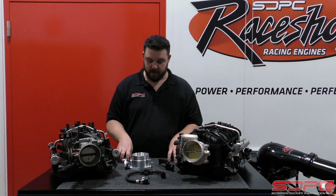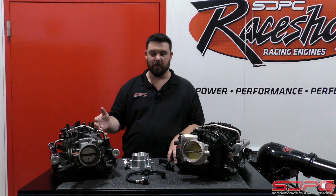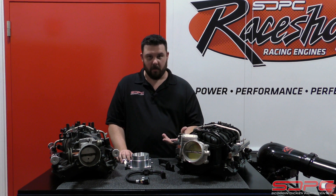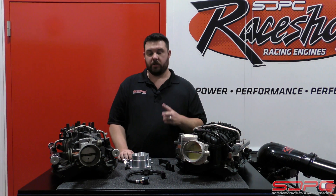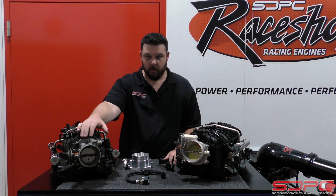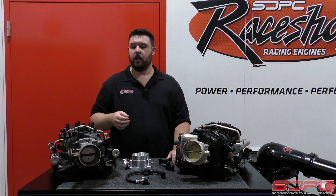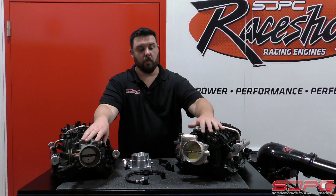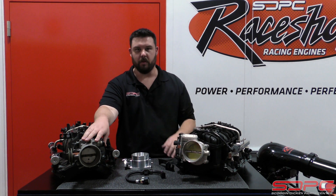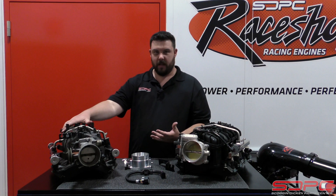The next is going to be the throttle body connections. Now your 99 to 02 guys, you have kind of a bum wrap on the fuel system having to convert from return style to returnless, but you catch a break on the throttle bodies because it's cable throttle — it's easier and cheaper to adapt. There are two ways to do it. Your old throttle body is a 78 millimeter with a three-bolt connection. They make adapters — Holley, ICT Billet, and others — to adapt your old throttle body onto the newer four-bolt intake snout on the Trailblazer SS, which is 90 millimeters and handles up to a 92 millimeter throttle body.